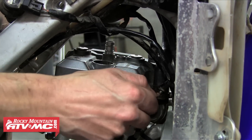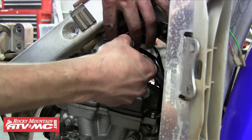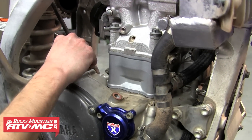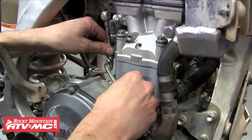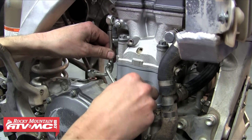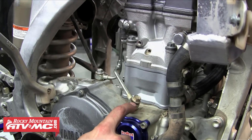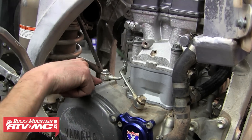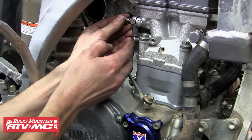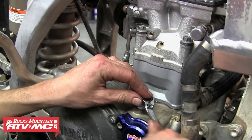After that we're going to reattach the ground wire running to the cylinder head and reinstall the spark plug cap. Now we can work on reattaching the oil supply lines. We're going to set a crush washer on both the bottom holes and then sit the lines on there and thread both bottom bolts into their holes. Make sure there's a crush washer going on with the bolt so it seals the line fitting on both sides. Now we can install that top bolt, placing a crush washer on the back side and then threading the bolt with the crush washer into the cylinder head. Once that's in place we're just going to tighten all three of those bolts down.